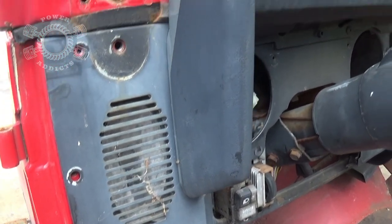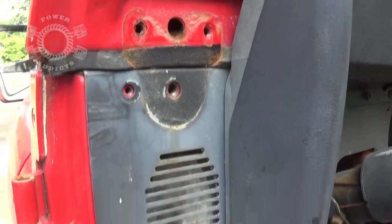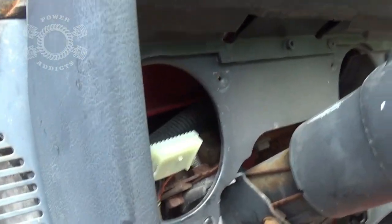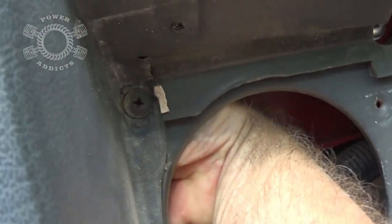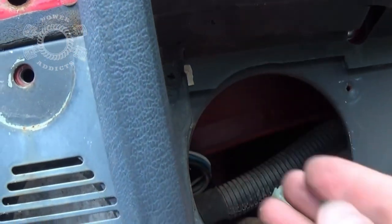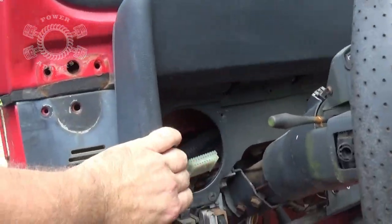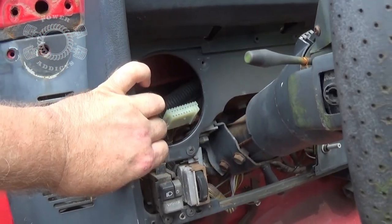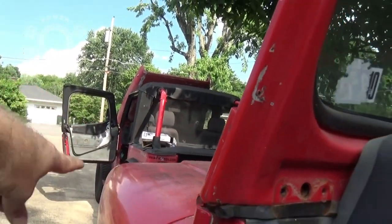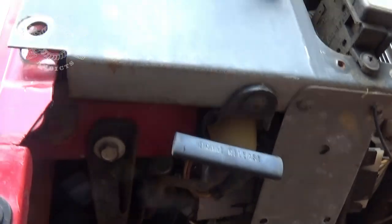Rust bucket still has the driver's side speaker, and I've got all the dash components — nothing taken out of it. I was making videos a while back on how to remove stuff, so I went ahead and took these right here out. You can see that speaker nut — the top one you're not going to get to very well, but if you take your cluster out I can touch it right there. With a regular socket I can get to it if I remove the speedometer. I'll link those videos on how to remove the speedometer. This one's a 93, that was a 91 — the speedometer clusters come out a little different, but not by a whole lot.